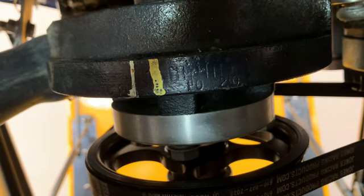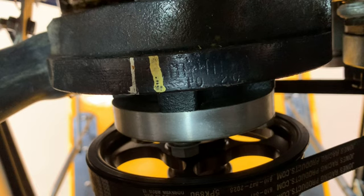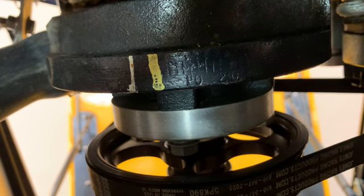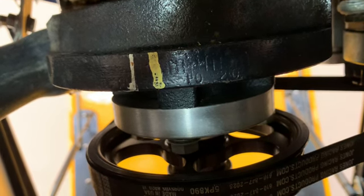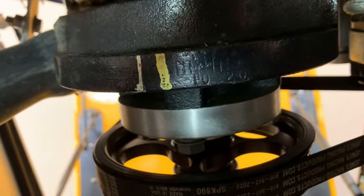So definitely need to pull the bolts out and figure out where the key is on this balancer and get this thing set to the right position and make sure the timing pointer is right, and then I can go ahead and time this thing right.